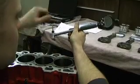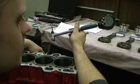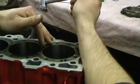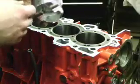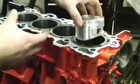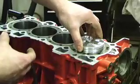The next thing is to check the bore on the corresponding axis. As long as that checks out, the sleeve is true and bored correctly, and the piston-to-wall clearance is what we're after at 4.5 thousandths. After checking with the dial bore gauge, it's still a good idea to put the piston in the bore and just make sure there's definitely enough clearance — even after measuring, just check by feel. I put the skirt down in, rock it back and forth, just to make sure it's not too tight.